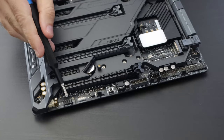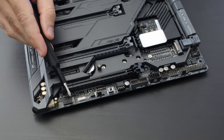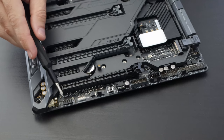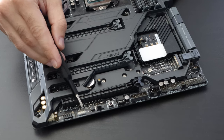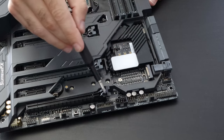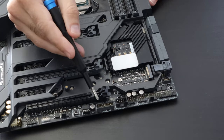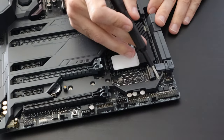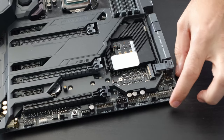At the bottom you have several other headers. This header here is for your front audio — your headphone jack and microphone port. A cable inside the case runs to this set of pins. The header with the white plastic outline is your RGB header, used to connect your RGB controller or RGB fan controller. Down here you also have USB headers for front-panel USB 2.0 ports, and your front panel connectors for the power button and reset switch — all labeled right on the PCB.